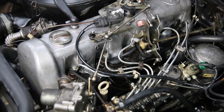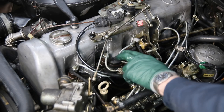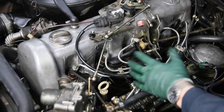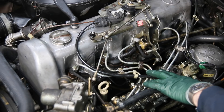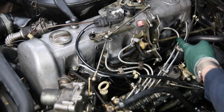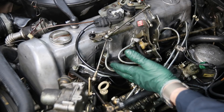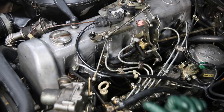There are a number of reasons why you'd want to remove these. Number one, you may have to rebuild your fuel injectors or test them, so you're going to have to remove all these lines to get to the fuel injectors. The second reason is you may want to do a compression test, and in order to do a good compression test the way I like to do it, you want to do it through the holes in the fuel injector, so you need to remove these lines.